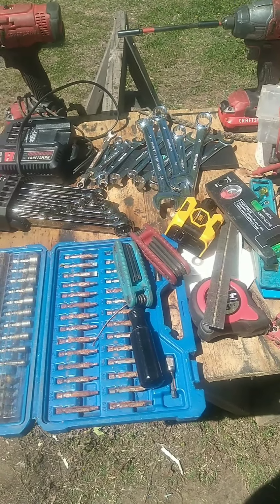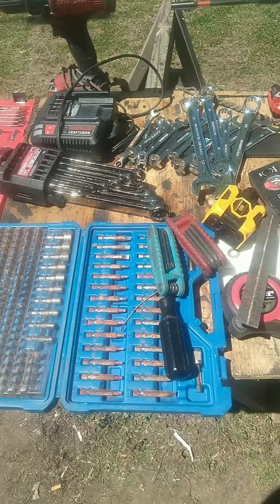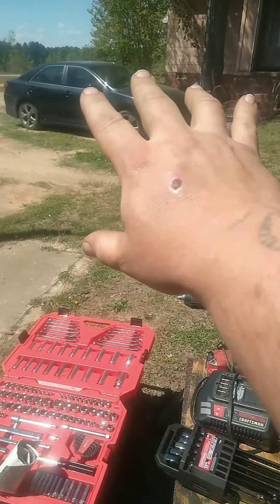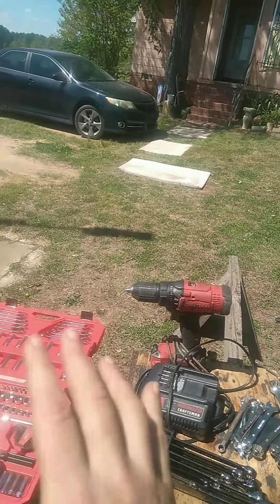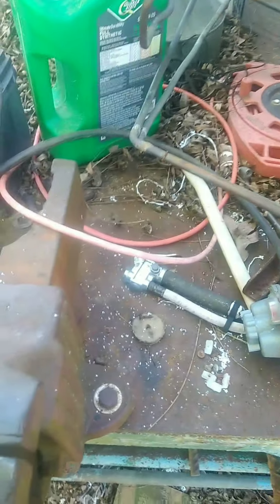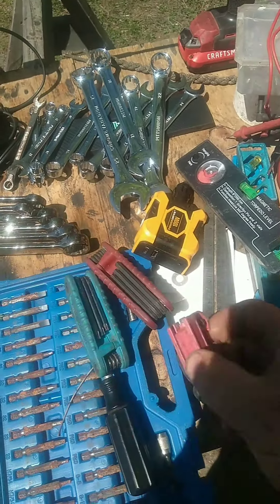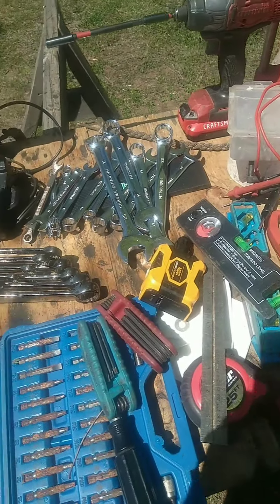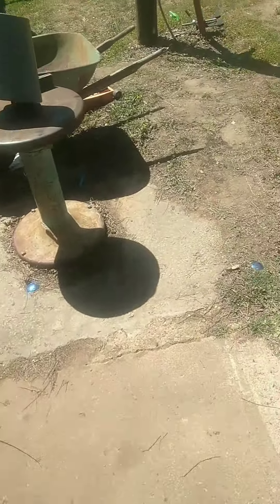Think about your own situation. Keep a spare serpentine belt and know how to change it on your car, truck, van, or school bus. You can repair lines — have a piece of fuel-rated scrap hose laying around, use some hose clamps, and fix a line. If you've got a way of cutting a metal line, take your needle nose pliers or a file, ream the line, put your hose clamp on it — you can cobble all kinds of things together.